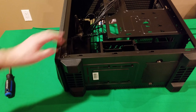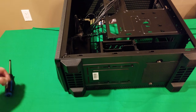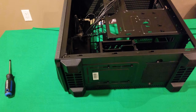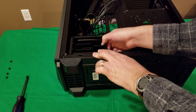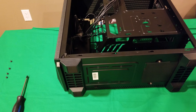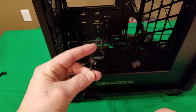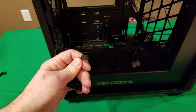If you want to remove the hard drive cage completely, take the screws all the way out, remove the bracket, install your power supply and manage all your cables, then put everything back in. To remove the cage, move it all the way to the end and tilt it slightly to get clearance, then lift it right out. Also worth noting: besides the molex connector, there's also a three-pin PWM fan connector so you can plug directly into your motherboard.